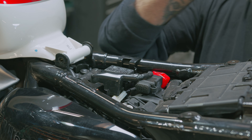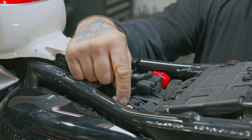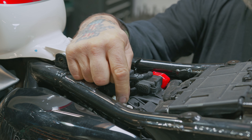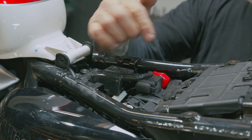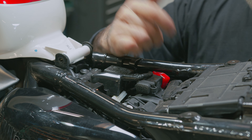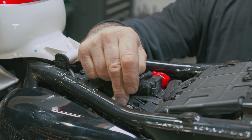We're going to start by removing our battery negative cable. You can use a 10mm or a number 3 Phillips head screwdriver. This is the black wire, not the red one. You always want to remove the black one first, which disconnects the battery from the bike. If you disconnect the positive first and arc it out on the frame, you're going to ruin your tool and your frame, possibly the battery. So always disconnect the negative first.